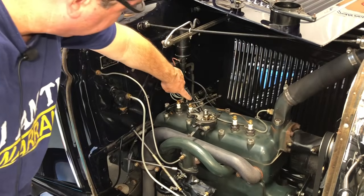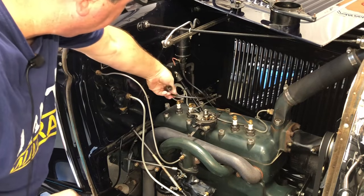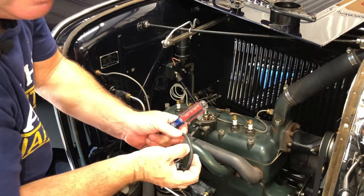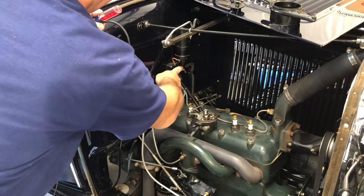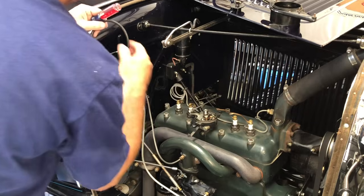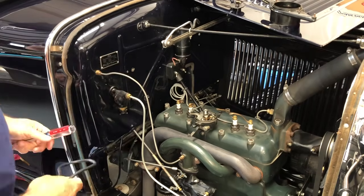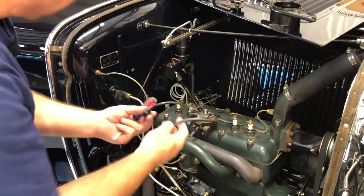There's a little bit of sparking between this lead and the ignition cable here, so I probably have a bad spark lead. There's been a little bit of arcing going on here. Apparently this lead, which has always been a little too long anyway, has been making a path along the ignition cable to the top of the distributor — occasionally jumping outside the jacket and arcing against the ignition cable. That's easy enough to fix. I'll just throw a new one of these on, but this time I'll get the correct length so it's not rubbing on anything.